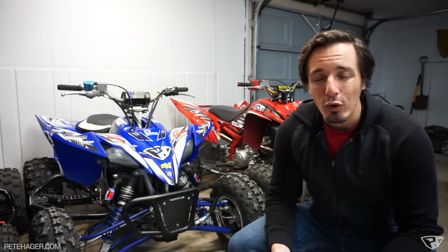I think they're great. I was a little surprised, or at least we were a little surprised with the results on the Raptor. The anti-reversion headers are supposed to help build more torque and help with throttle modulation. So overall, I think the rideability on the Raptor is great. I did take it for the test ride to get those exhaust clips, but most owners and tuners have seen positive gains with these R5 pipes on their Raptors.